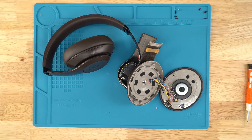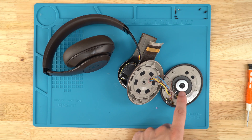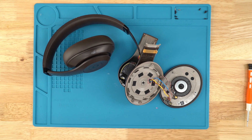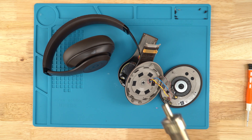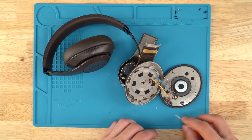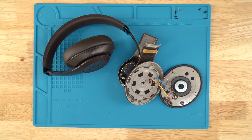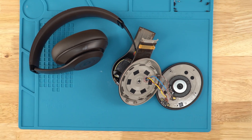When you open the right side, you're gonna notice there's gonna be glue holding these wires down right here — glue all over these ports. As you can see, these headphones have already been worked on, so the glue is removed. You'd use your heat gun, or even a blow dryer — just be careful not to melt the plastic since it has a smaller bore than a hair dryer. Use the flathead and carefully pry it up. It takes patience — you need to be very patient, or else you could pull up one of the contact points.